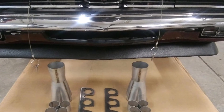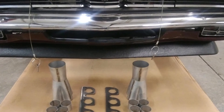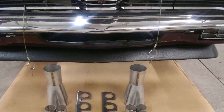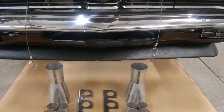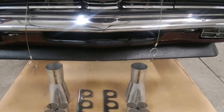The Cougar is still at my buddy JP's custom chassis and header shop. That's a picture of the Cone Engineering 7-degree merge collectors that we're building. The custom headers are going to be 2-inch with a step to 2-1/8-inch with those custom Cone Engineering merge collectors. I think it's definitely going to help the low end. Hopefully that'll be done within the next couple of weeks.